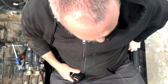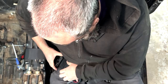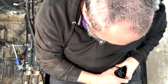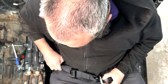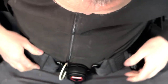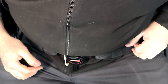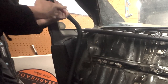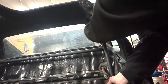Now have a seat and slap on your new lap belt. There are many moments of truth here — that one's way too far over. We need the red pulley on it. Let's tighten it up and get this cam right in the middle. Pull some slack out. Lap strap — check. If all feels well, then move on to the upper bolts on the harness bar that mount to the chassis and tighten them down as well. Then hit the bolts and nuts that hold the center bar to the side pieces. Congratulations — your harness bar is now fully installed.